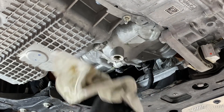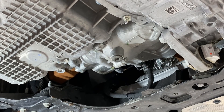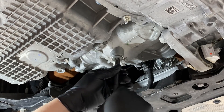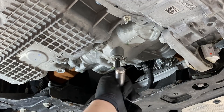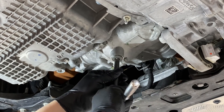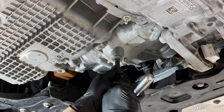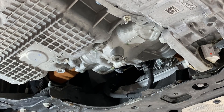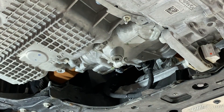This plug requires no sealant — it has a gasket built into it. Get it nice and clean and spin it on by hand to snug it up. The torque spec on the drain plug is 30 foot-pounds. You can choke up on the 3/8 ratchet toward the center point of rotation to reduce leverage for initial tightening, then torque it to 30 foot-pounds.